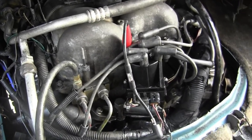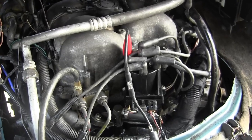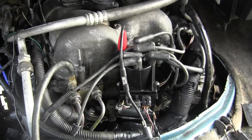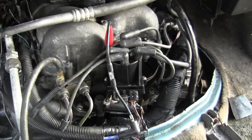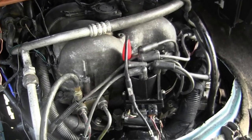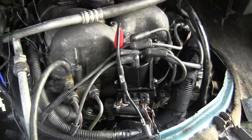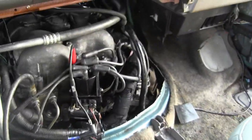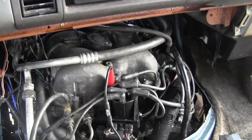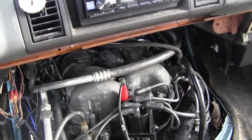I always have people complain about no spark on my Mercruiser 3.7 Marine engine group, a little 4-cylinder that makes big power, up to 190 horse in the 4-barrel configuration, 165 horse with the 2-barrel, and has a Ford head out of a V8 engine, marinized of course, and also has Ford pistons and Ford rods. I founded that group because people don't understand that engine very well. What a gem it could be if it's done right. And most people try to work on it like a steel block engine with a steel head, and they destroy it because the block is aluminum and it will flex if you don't torque the head bolts right. Keep telling people that. Service Bulletin 81-30, read it. Love it, live it, or your engine will self-grenade.